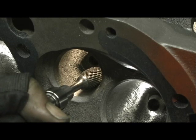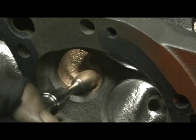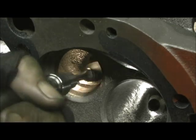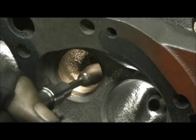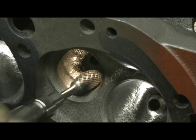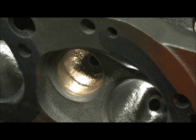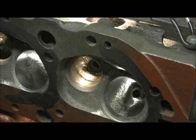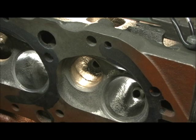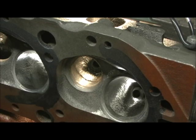Taking it slow with a medium to hard pressure, then a quick swoop. When comparing this from the small block to the big block as far as cutting time, the big blocks take about 20% longer than a set of small blocks on the same stage level because there's just so much more port. The cross-sectional area is so much more that the walls are taller, the bowls are bigger, and you find yourself working twice as hard.